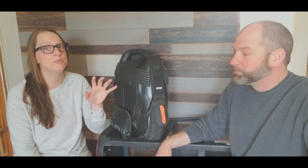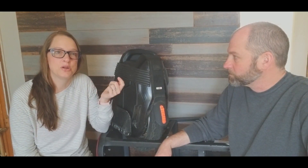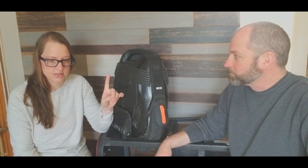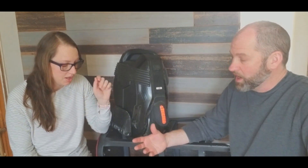We did the range test, and eWheels said it seems like there's a problem. The other issue that Shane noticed is that when we go to plug in the unit to charge from, say, 30%, it only takes about two hours to reach 100%. So we think there is maybe a bad cell in the battery, or maybe one of the batteries disconnected — it acts like the wheel only has half the battery.